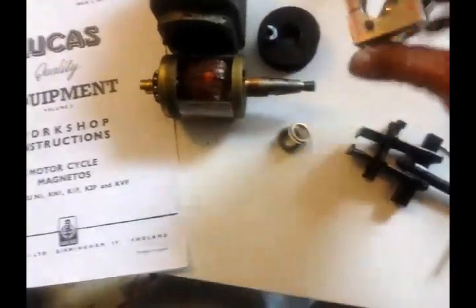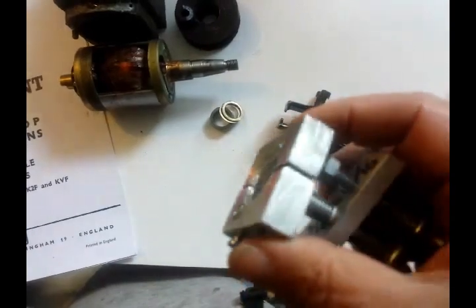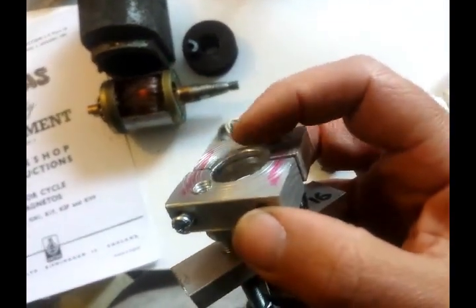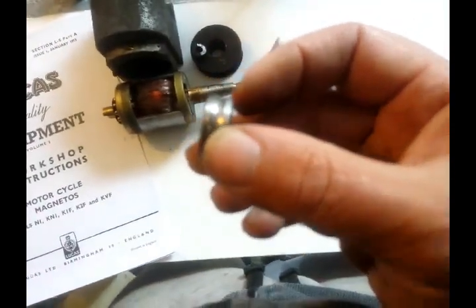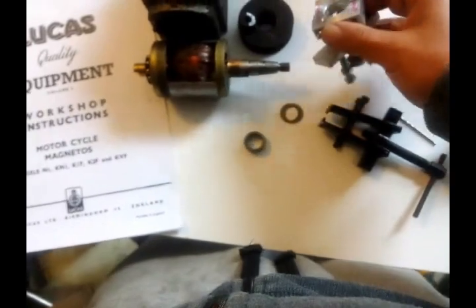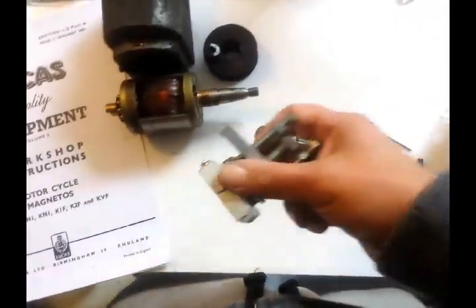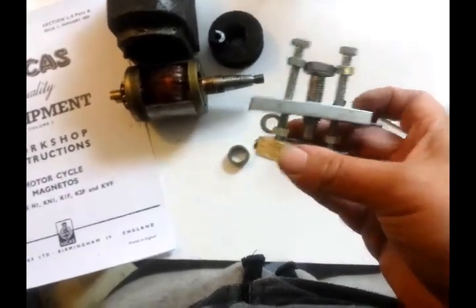I had to resort to making a 360-degree gripper like this one. It actually took me about three to four hours to make this thing. The best way to profile the inner race is to stick a bit of blue tack on it — you can just see the profile. You get a good idea of what the positive image looks like and can map it onto there. I went around the inside with a Dremel to give it the rough shape, kept trying and fitting it, squeezing it together. But even with this, that did not want to come off that bearing — it even bent my nice blob of aluminium bar. Eventually it came off.